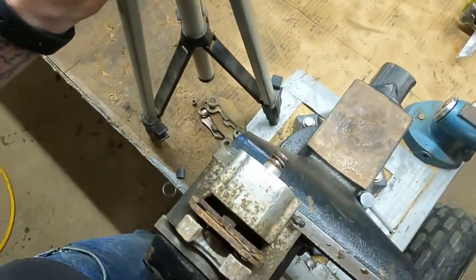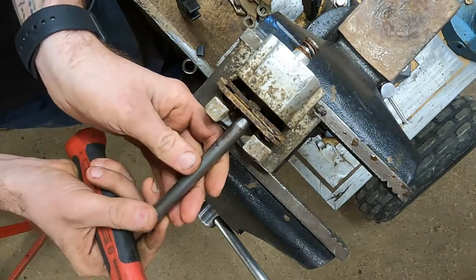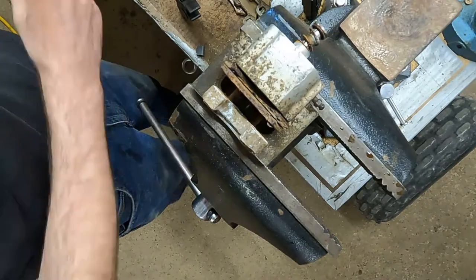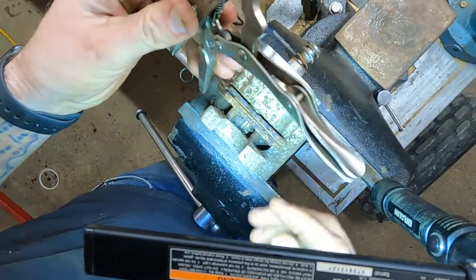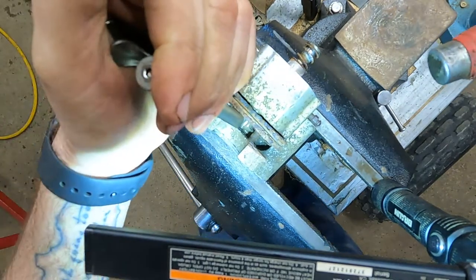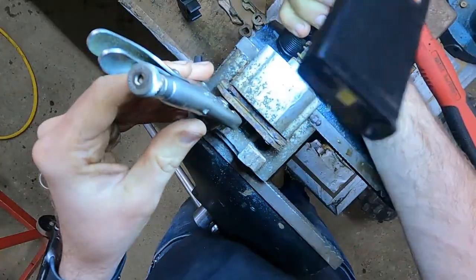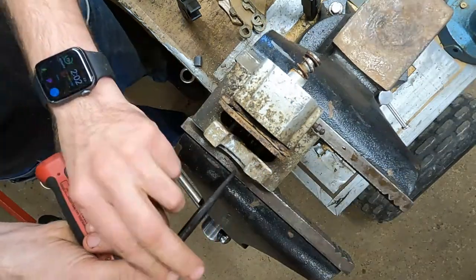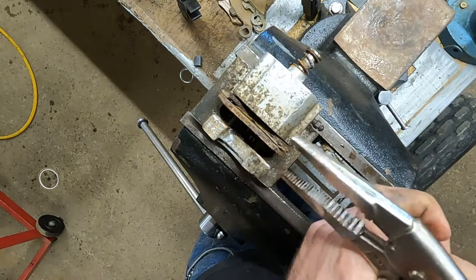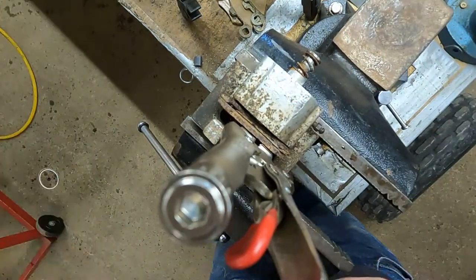What he had shown was to slide everything back. I'm less worried about being rough on this since we're putting in a new piston and brake pads. We're going to use needle nose vice grips and attempt to grab a hold of one of these pins. I'm trying to get them spinning but no luck. We'll spray a little penetrating oil on this, then try to put a punch on the pins to get them moving. That one moved a bit. No wiggling though, so I'm going to put a little bit of heat on this.